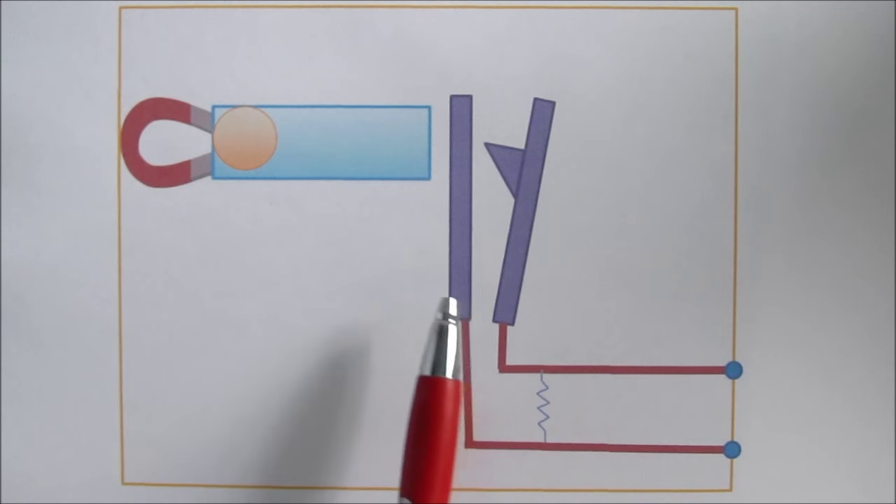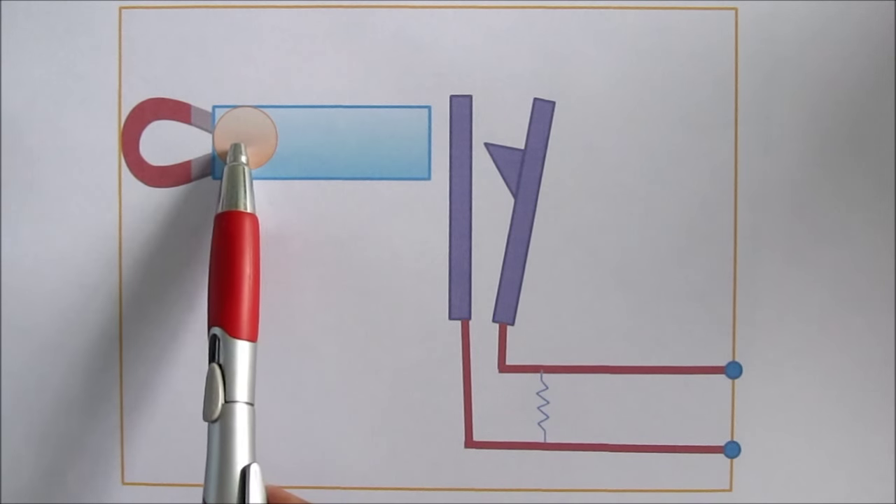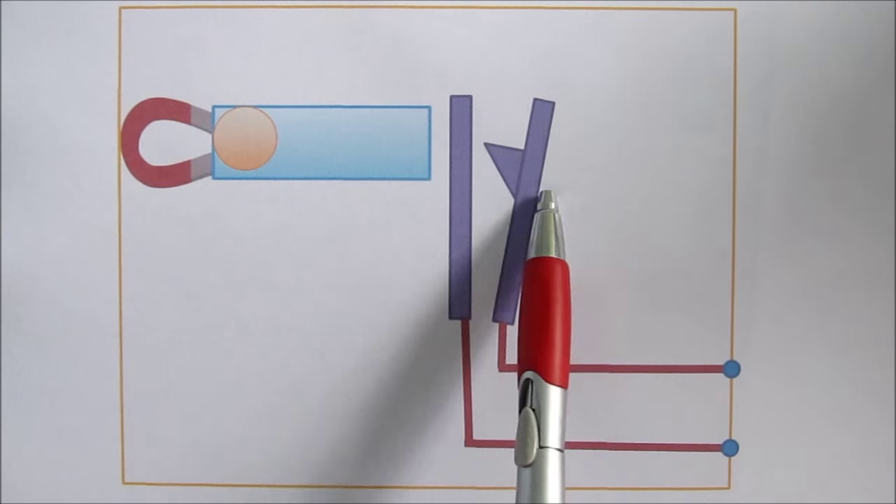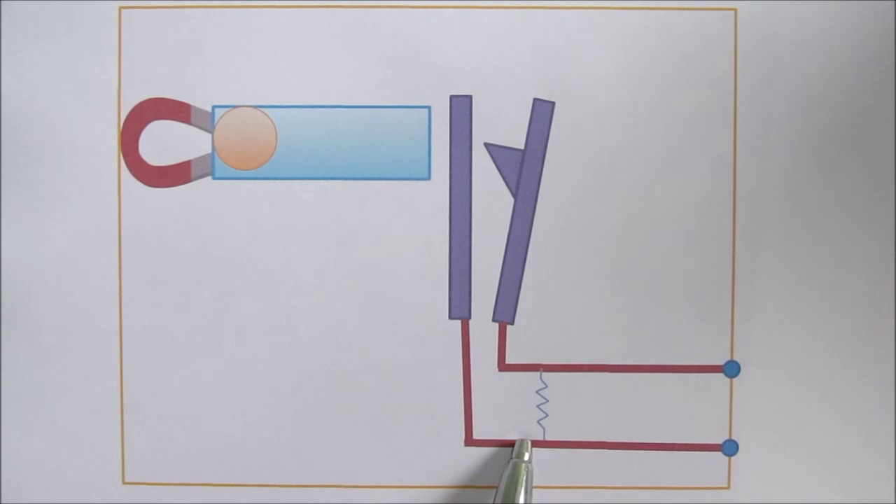This here is the ball and tube type of airbag sensor. It basically consists of a ball in a tube, as well as a magnet, with a pair of contact switches and a diagnostic resistor. The system uses this diagnostic resistor every time on startup to make sure the sensor is functioning correctly.